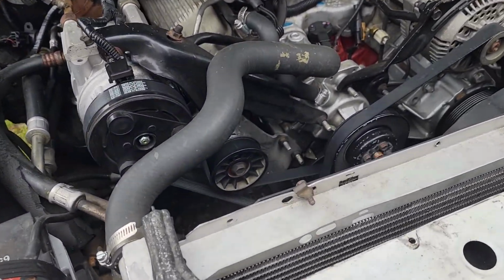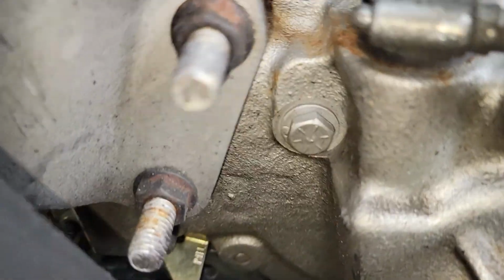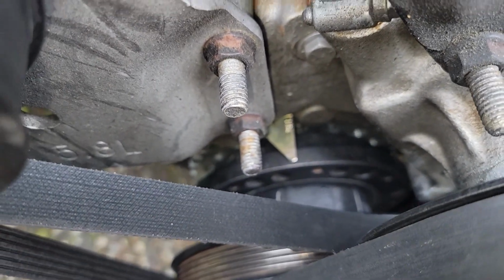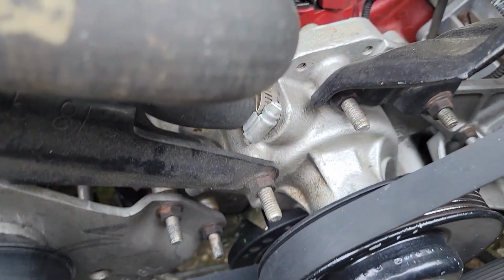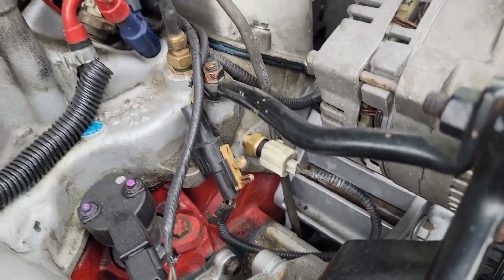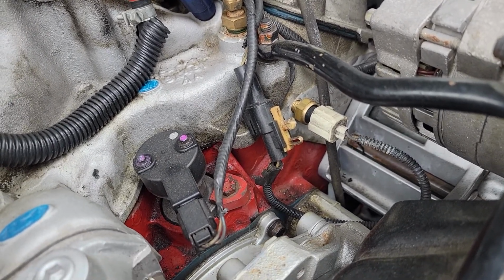So yeah, it's got a crank sensor off an Explorer, custom modified 28 ounce imbalance harmonic balancer with an Explorer tone ring pressed on. Cylinder head temperature sensor is threaded directly into the driver's side cylinder head, almost like it would be on the 4.6.